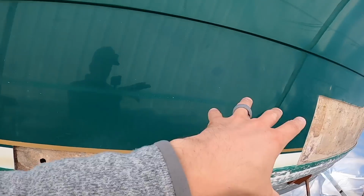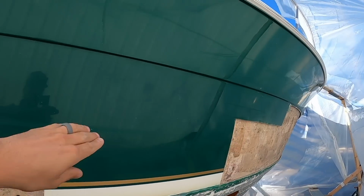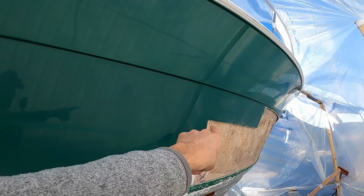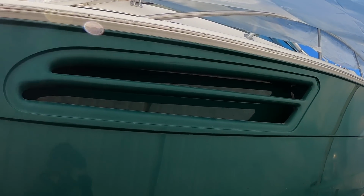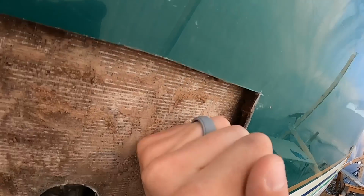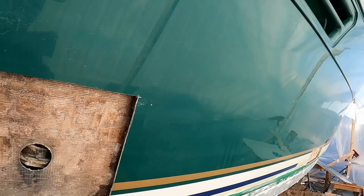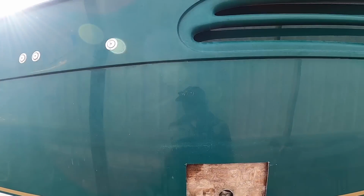So he may have to cut some more coring out of these hull side sections, but in all honesty, the moisture meter is reading good in these sections. It's dry, as we can tell, as we cut more away. And then where the issue is, see, very much so, rotten coring. This was actually the air intake grate on the hull side. This was the drain for that section. Look at this. I mean, just completely rotten all around this. So he's gonna cut out, and it's delaminated as well, as you can see. I mean, at least a 1/4 inch delaminated off of the inner liner. So he's gonna cut out all this and then extend that aft. And again, Coosa board around this, so it's sealed, balsa coring around that, epoxy filled.